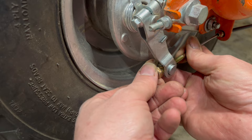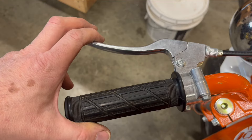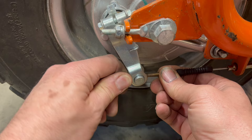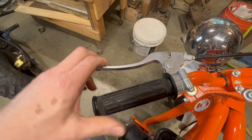To adjust your brakes, get your bike up on blocks so the back wheel is not touching. Your back wheel should spin freely until you hit the brake lever. Up here you should be able to squeeze the brake lever so it doesn't quite touch the handle. Mine's a little too loose, so we'll tighten this a few turns. Check that we still spin and stop — and now we can pull to about here, which is good.